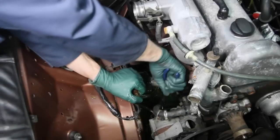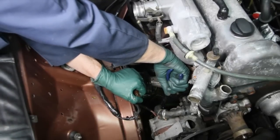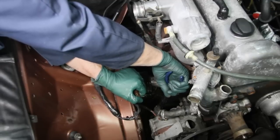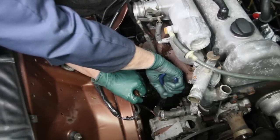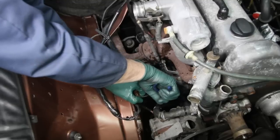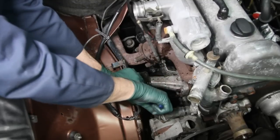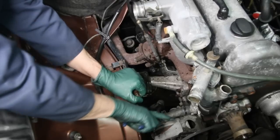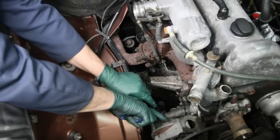I'll plug the hole here and aim it right down onto the drip pan. Now, even though I've drained the radiator, look at how much coolant is in the block. This is the best way to drain the block after you've pulled that bottom radiator hose or removed the plug. I'm going to let this drain a little bit and then we'll come back and remove the other one and inspect that housing for corrosion.